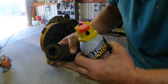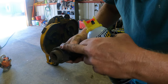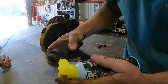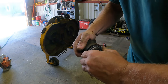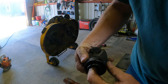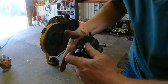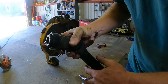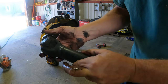Here's another use for the light oil — these little balls and springs inside the PTO shaft coupler dry up and there's no grease fitting there. There is a grease fitting for the U-joint inside, but not for the coupler itself. Go ahead and oil the splines, make sure it springs back freely and the balls are moving nicely — otherwise it's going to be hard to put on and take off. Checking the U-joint for binding or extra play — this one is nice and tight, free, no issues. Going to clean off the grease fitting and put some grease in there.